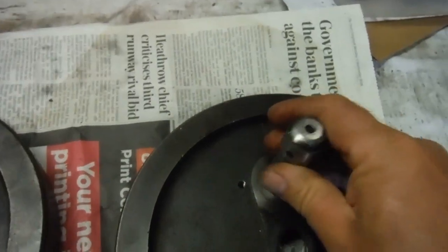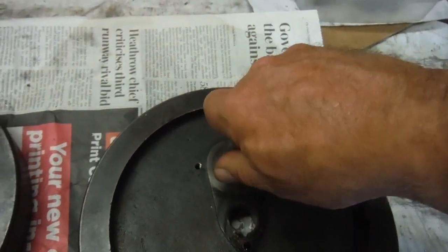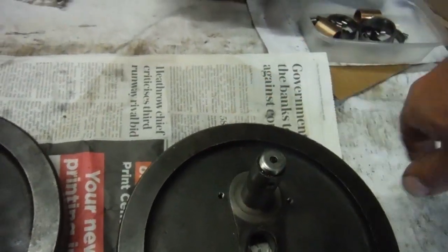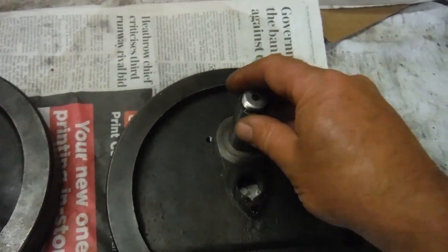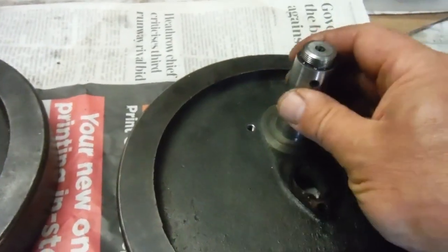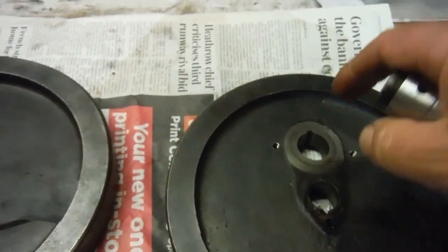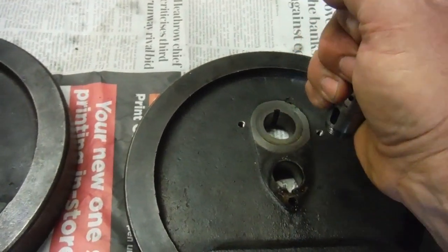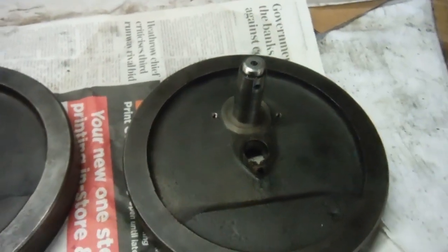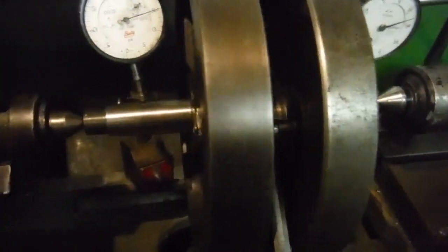With the replacement flywheels and the new crank pin, because there was a tiny wobble, I decided to lap it in with very fine grinding paste and oil — just lap it for half a minute or so, then clean it all off and check again. I had to be careful not to go too far, as you're reducing the overall width of the assembly as the crank pin settles in. Eventually I got to a point where the crank pin would just drop into the hole under its own weight and stay put, with the pin and boss perfectly matched to each other. I did that with both ends of the crank pin in both flywheels.